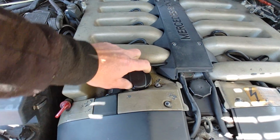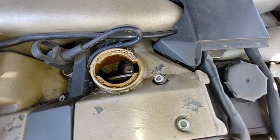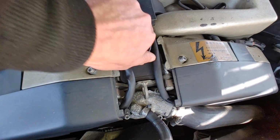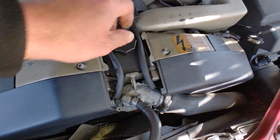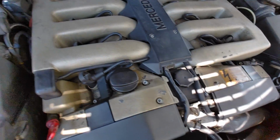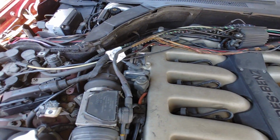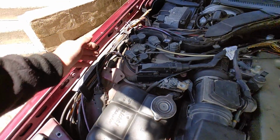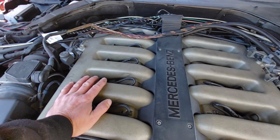Let's take a look real quick in the engine just to see what's going on there. And the engine is extremely clean. It's in extremely nice shape, well, given the miles, you know. Power steering is low. It's probably leaking somewhere. Slight leakage because power steering does work. Upper harness was replaced. You can see the stickers here. So upper harness replaced. I did these throttle bodies, rebuilt those. These are my looms. Very familiar looking because many of them done like this. Both sides, because this car would go into limp mode and now it does not.